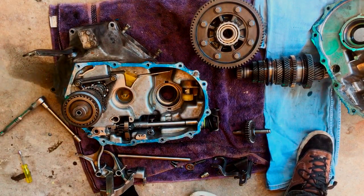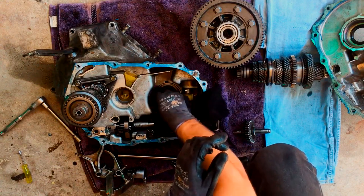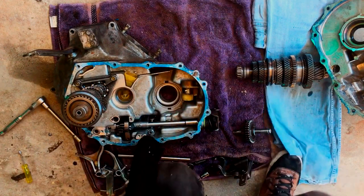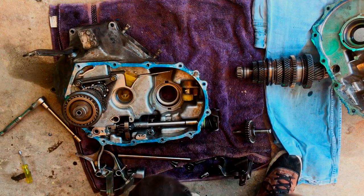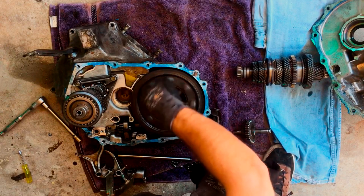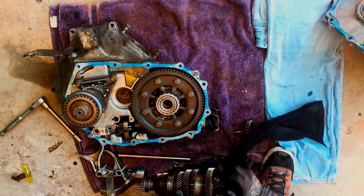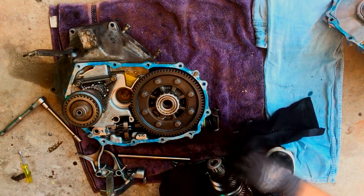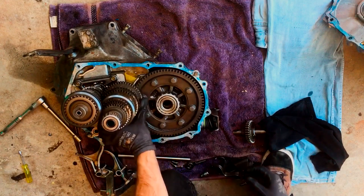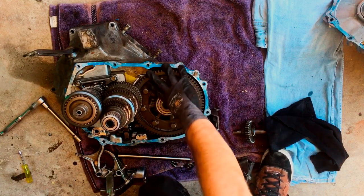Next is the diff. Go over the diff racers and give them a good clean in case any dust or dirt has fallen in. Give the bearings themselves a good clean up and it should just fall in there. Give it a spin to make sure it's sitting correctly. Next up will be the output shaft - give everything a nice clean up. This obviously only goes in one way; it can be a little bit hard sometimes to get it in properly. Give it a spin and make sure everything is spinning smoothly.